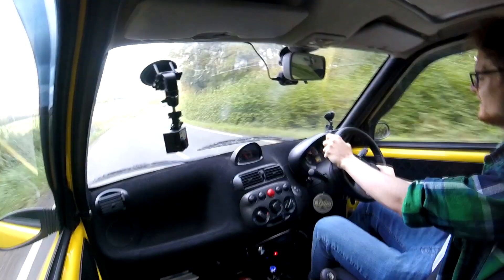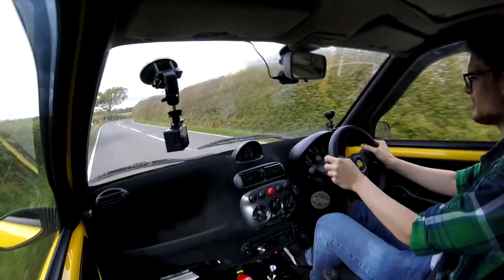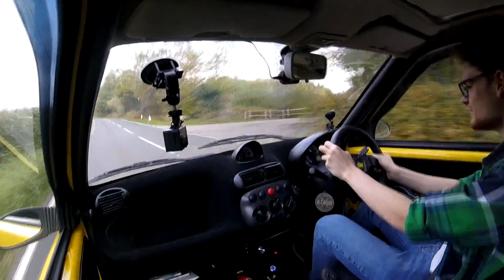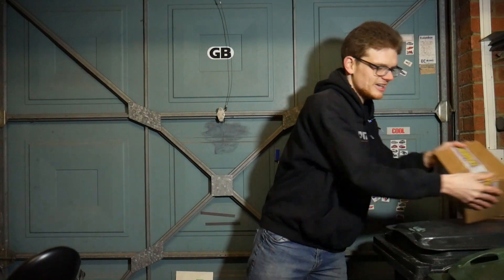For me the turning of the car is great, it's really sharp and it does go in when you turn it, but not quite as responsively as I'd like. I like a car to be fingertip-sharp. There is just a tiny little bit of slop in it, and also a little bit of roll when you're going around a long tight corner. The solution to that, because you've already got coilovers on the car in my case, is to look at your suspension bushes, because standard bushes they're made out of rubber — they're flexible, they're soft. That makes them better for comfort and better for refinement, but not as good if you want sharp B-road bashing handling.